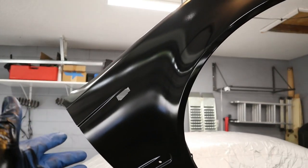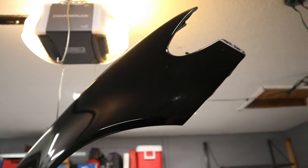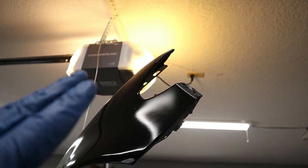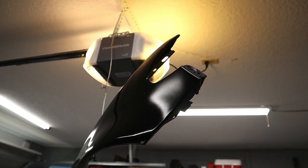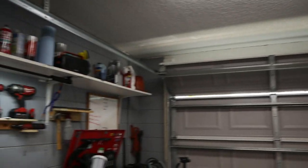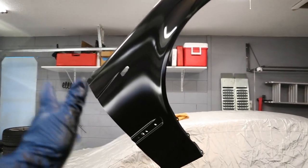So it's still a little bit glossy because it's drying, but once it's fully dried, it's gonna go back to like a satin finish. I think I'm going to have to sand that down, maybe with like a 2000 or a 3000 grit sandpaper, and then we'll load up the gun with a little bit more paint because we're empty. And once we get that corner done, we'll be able to move on to clear coat.